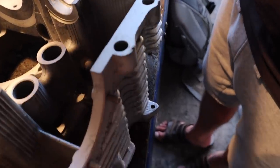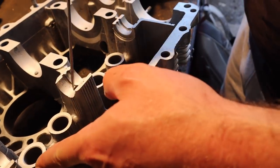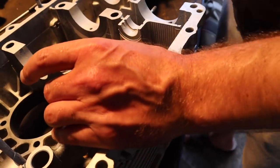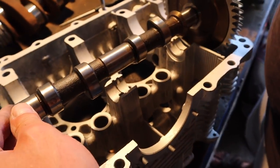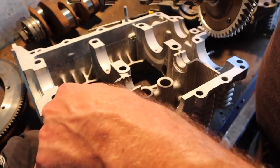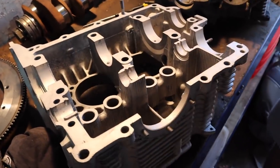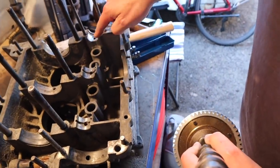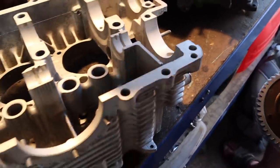What is this - is this supposed to be like that? That one's got a hole in it for oil to come through - I think that's an oil gallery. So this one has oil coming in lubricating this journal for the camshaft. But how does that get lubed? There's nothing there. Ah, sorry - my mistake. The lube would come out the other one. Yes, that's the other half, and clearly that's what supplies the lube.